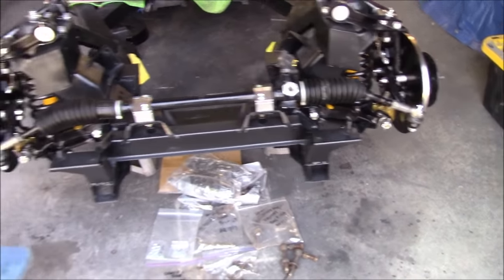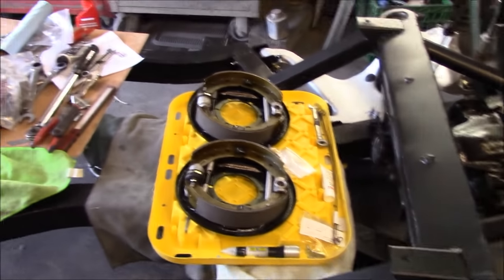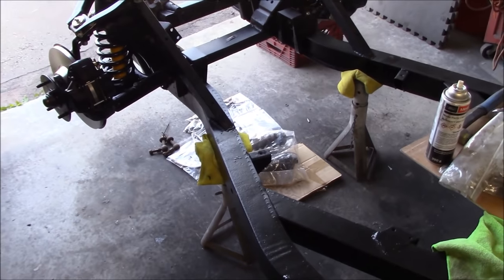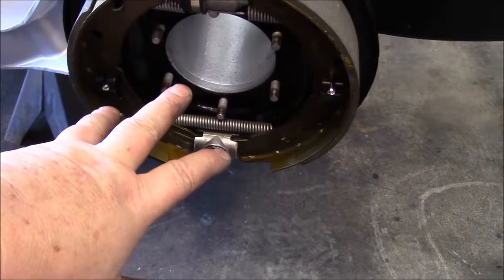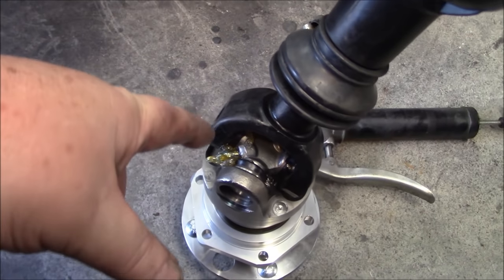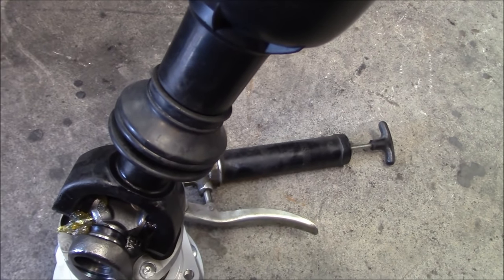Looking pretty darn good. Quite happy with the way that's turned out. I can now put the brake back plates and hubs on the rear and move on from there. We're running out of things to do, which is a good thing. Still have the radiator protection shield and the front sway bar to do. So let's do the brake back plates and hubs. Back plate is on. Hubs are out and we're making sure we grease the universal joint here, because you cannot access that once it's in the pocket inside the trailing arm. So make sure you do that before you install it. Also going to grease the sliding splines, and then we'll zip tie the boots on once we get it on the car.